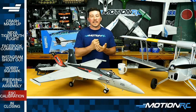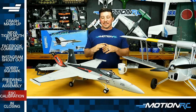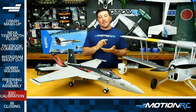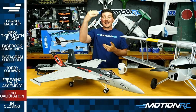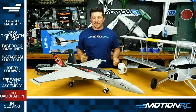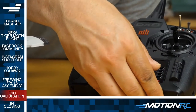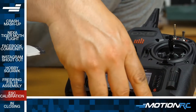You should always calibrate your ESC on any model, out of the box anyway. Basically, I was moving my throttle up on this one, and it wasn't until, like I said, 20% that it responded, so I was losing that top-end power. Alex, we have video. You want to roll it? Show it. Here's where we go, and I'm talking through it. Yeah, let them listen.